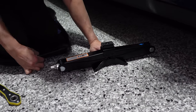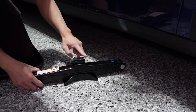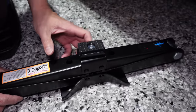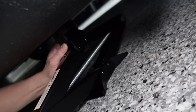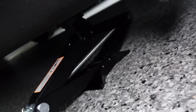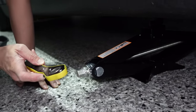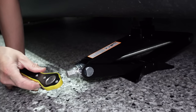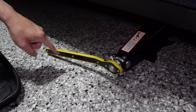Now time to jack the car up. Make sure your car is in park on flat ground. This is the jack that comes with the kit — make sure this rubberized piece is positioned underneath the hockey puck, and that's basically where you need it to be. At this point you can just finger raise it to start with, just using your finger to turn to make sure you are in the correct position. This jack is rated for 2,000 kilograms — obviously you're only lifting up one quarter of the car, so you should be okay.